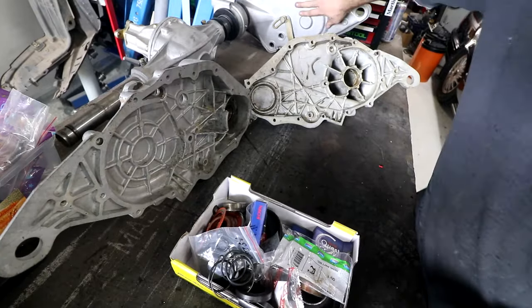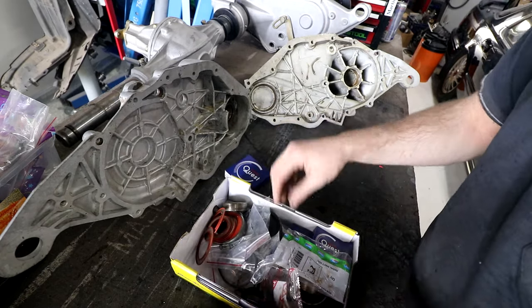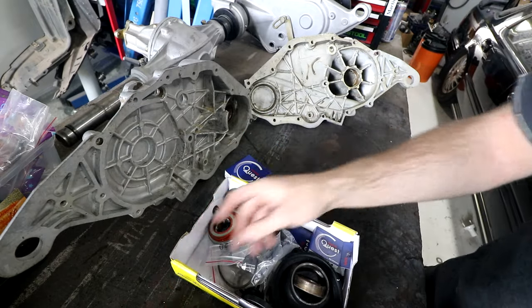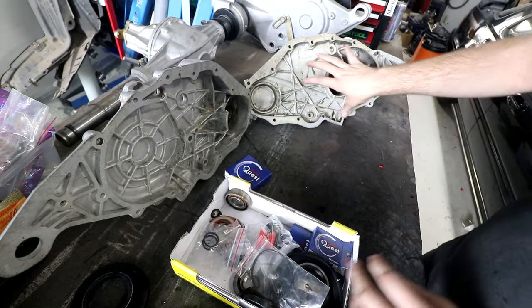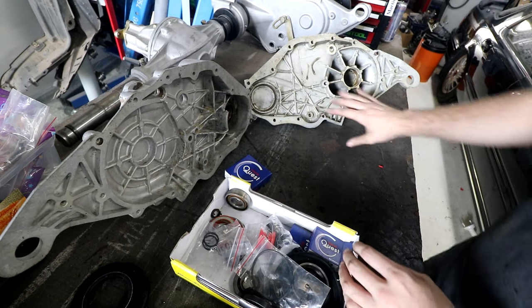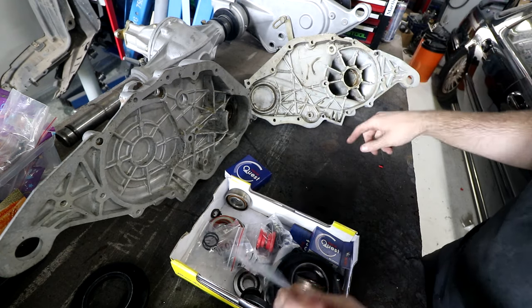The one thing I do remember is I actually deviated slightly from the way these are supposed to be put together. That's why I have all these bearing seals that are no longer in bearings. So this whole case is filled with oil when the car's running. On a motorbike we have to grease the chain every time you ride it or whatever. Here you actually fill this with oil like a gearbox, and it's half full of oil and the chain's just constantly in oil.